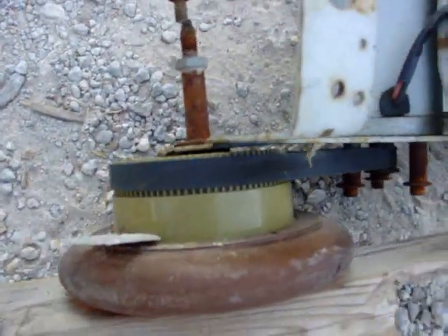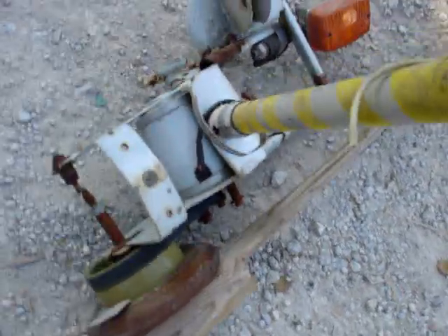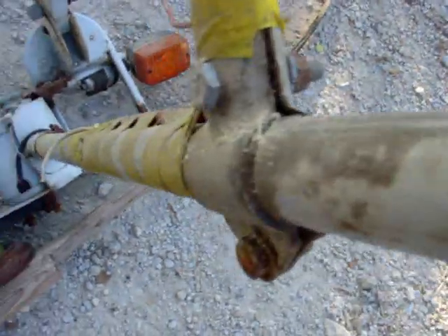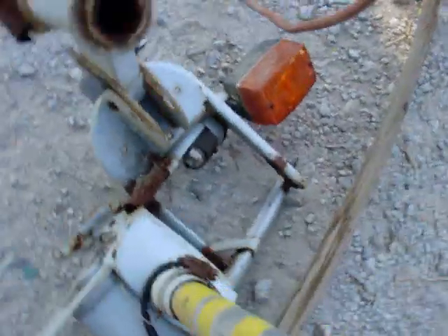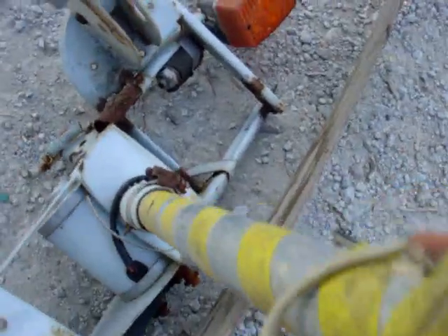Part of the wheel was over here while the wheel was here. All I did was flip it over, took the spacers out, dropped this out, put the belt on it — it worked pretty good for a while. You can tell by the framework it's kind of messed up. This is where the seat used to go, and this was the rear fender. I cut it in half and flipped the front end completely over, then straight across I put the two welds.